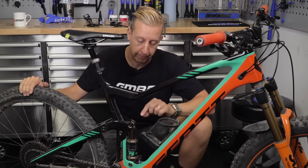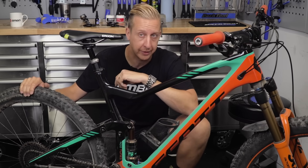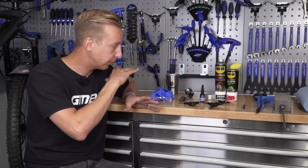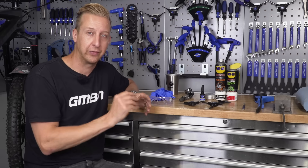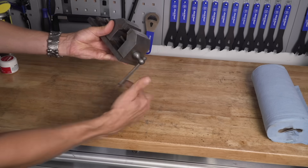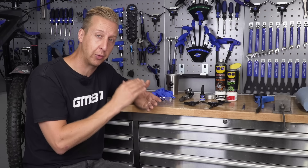These are very simple. You remove the bolt, just take the bushes off the top of the shock, and then you can slide the body off. But on the new style RockShox shocks, it's a little bit different. So you're going to need a bunch of tools to get this job done - it's pretty simple stuff despite what you might think. First up, you're going to need some sort of shop towel, rag, something lint-free. Next up is a vise. Make sure, if you do use one, it has soft jaws, because you don't want to damage the end of your shock. It's not an essential though - you can do this job without that.